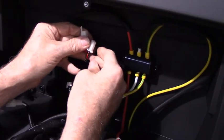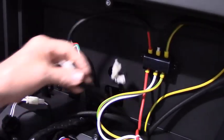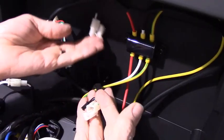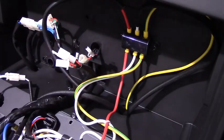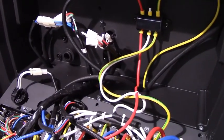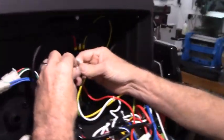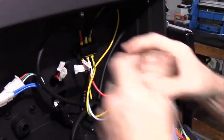And these 3 plugs here are connected to the fuel selector valve in the back. This half goes to the wiring harness. So the half that goes through that hole, you could ignore that. The half that goes to the wiring harness, if you get your bag of small parts, first thing in the bag of small parts will be a blind plug. And it will go in here, and that's simply to stop anything from getting in here and shorting it out.